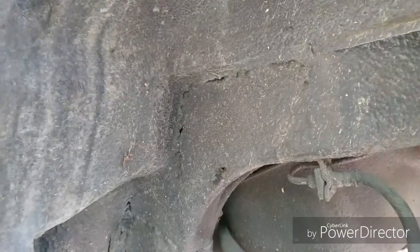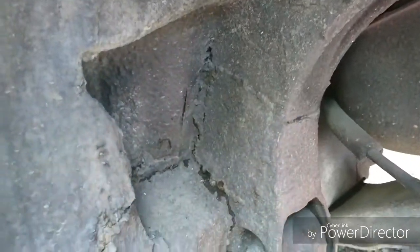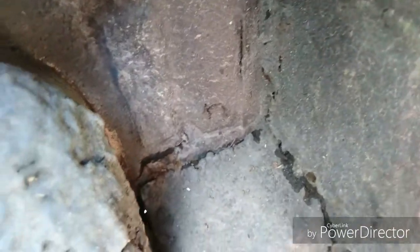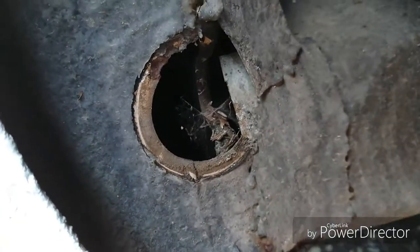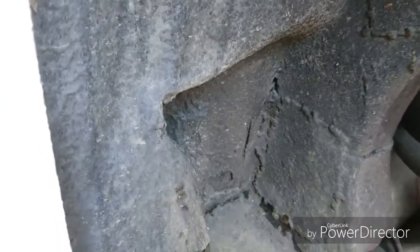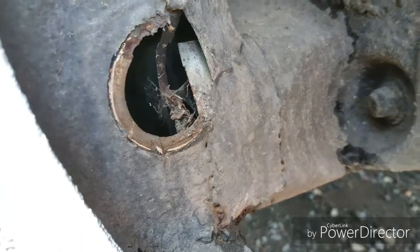This is one of the reasons I didn't try and save this chassis — you can see it's been welded in here and they didn't do a very good job. Very average. Why would you even try and save this when it's at this point? This is the biggest weak point for cappuccinos — they just rust. When Suzuki made them, they cut every corner in regards to rust protection.